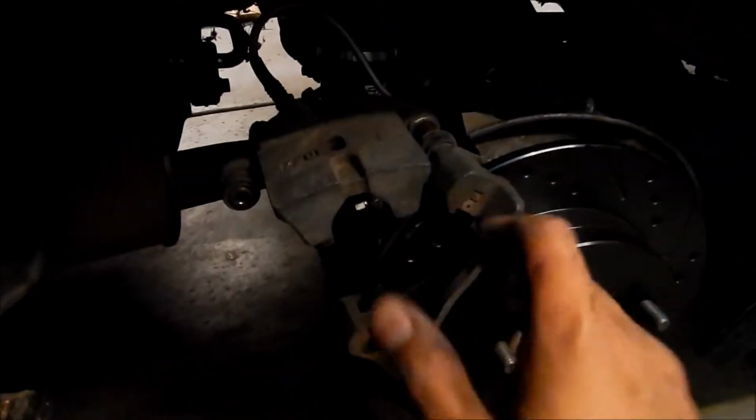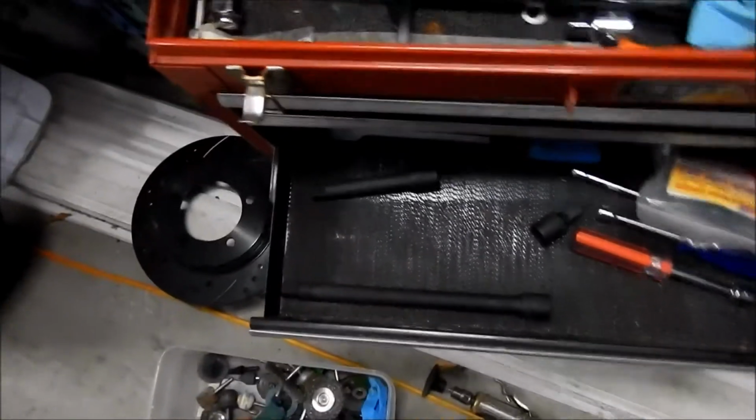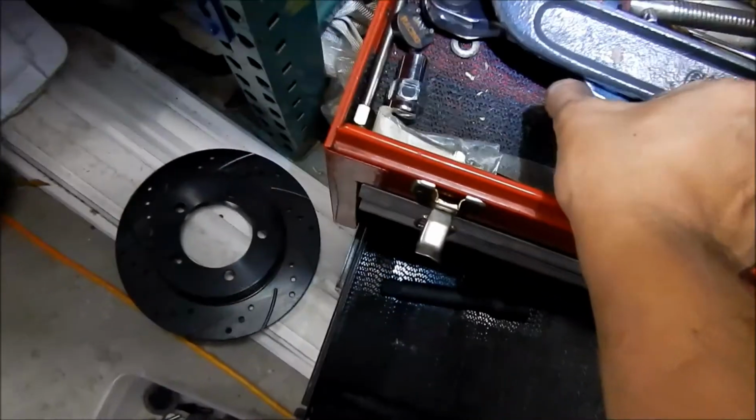Actually, this is the kind that you have to use the little magic box to do. Where is that guy? Yeah, the manuals are like no help at all, dude. Apparently different models of Galant have different brakes and stuff, and it's a pain in the ass. Anyway, you got to use this tool to reset the piston. I don't think we're gonna have to move it back too much because those pads look like they're not even worn.